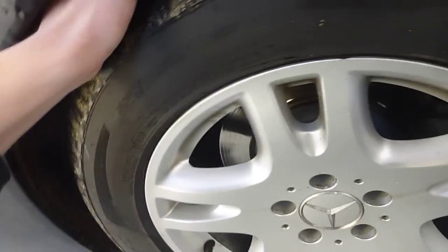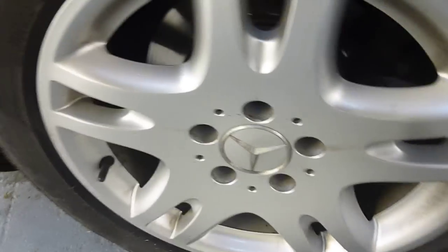The offside rear tyre is on 4-5mm tread, and I can't see any damage to the alloy. Just on the offside rear bumper there's a bit of a light scratch — you can only just get your nail in, so compound would probably improve that.